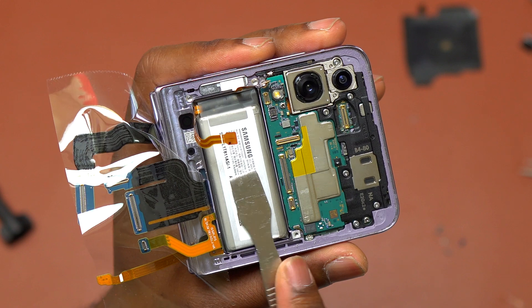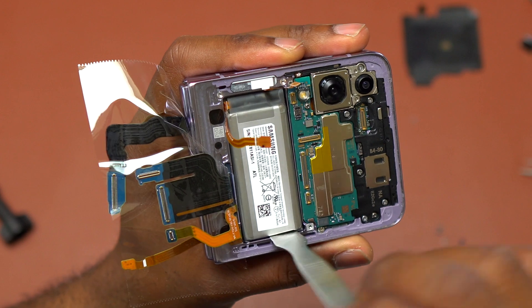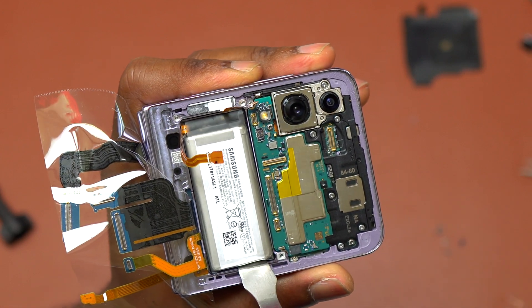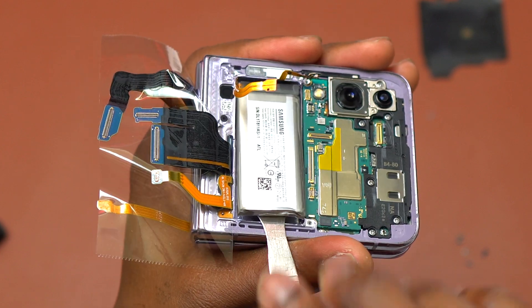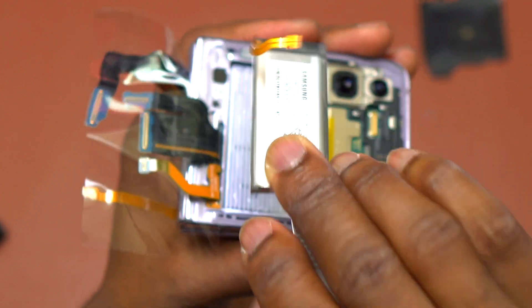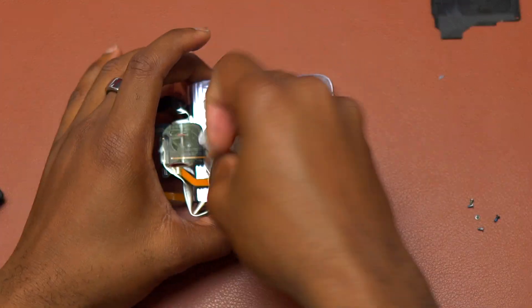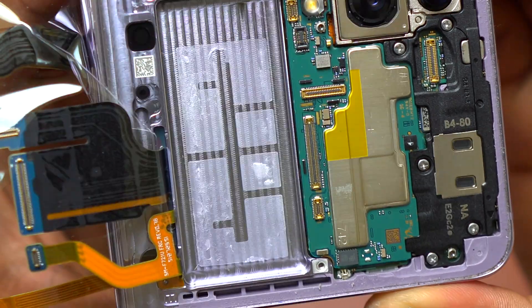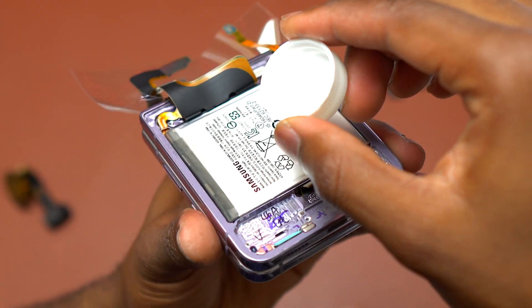I'm using my flat metal tool — this tool is not sharp and cannot cut the battery. The bottom of the battery is where I inserted the tool all the way to the frame and then started pulling the battery out. If you have enough alcohol at the bottom, you will be able to pull the battery very easily. Any excess alcohol you see on the inside needs to be wiped out; as soon as it is out, it will dry automatically.